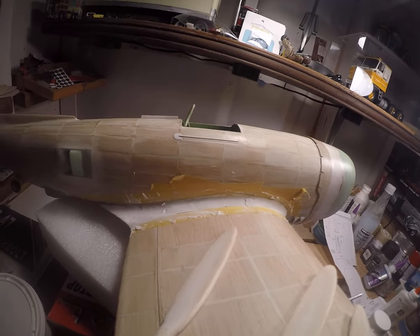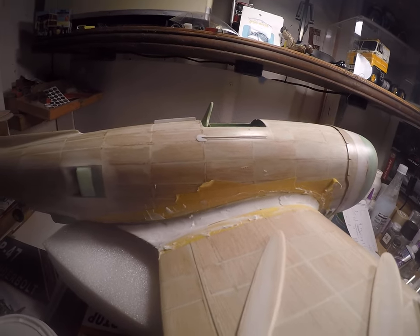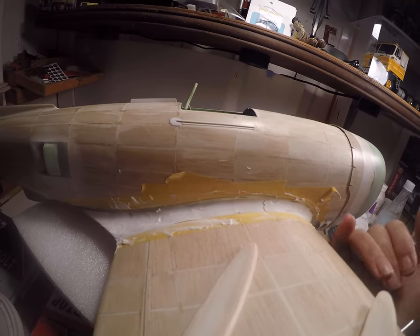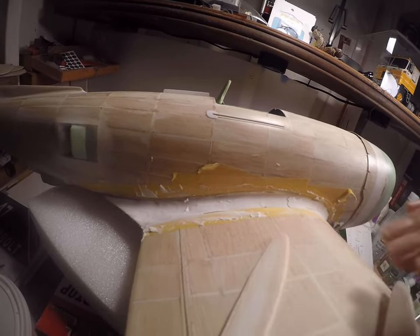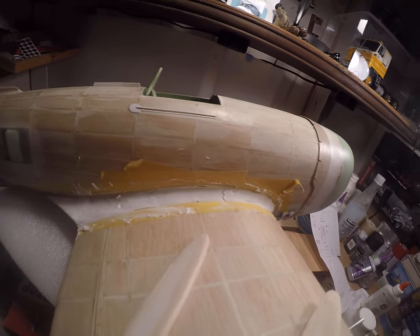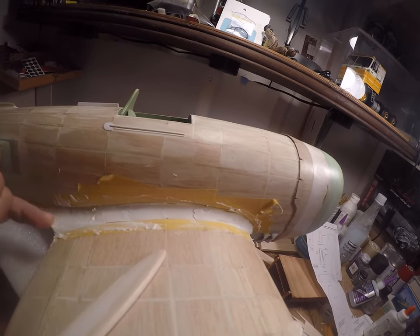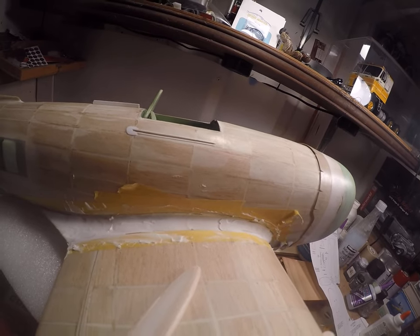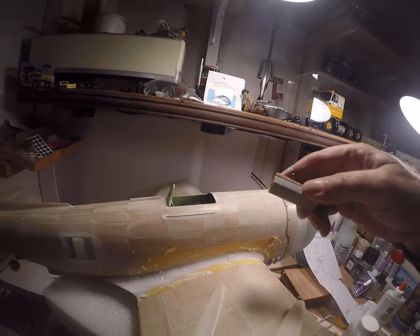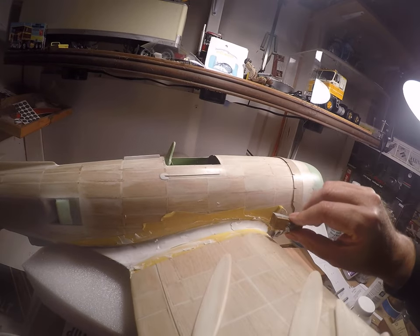That masks off — just like masking for paint, you're masking for filler. When the time comes to pull the tape away, if you lift it and then pull it at a right angle, it'll slide out from under for the most part. It might leave a chippy edge, but that's what your filler does — you come back with the wet filler, lay that along that chipped edge, and it'll reestablish the line that you want. Then using sandpaper on a small block, you can shape those lines exactly how you want them.